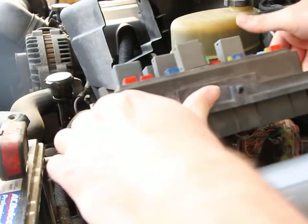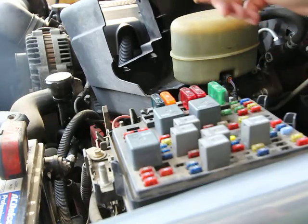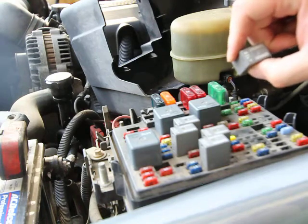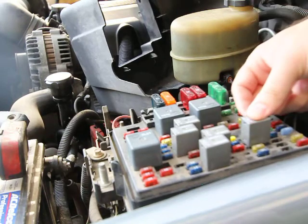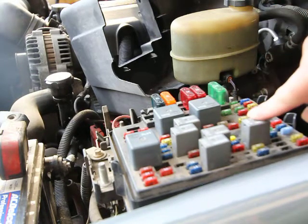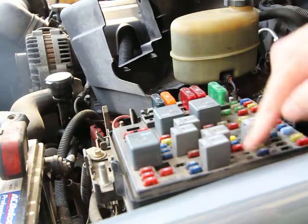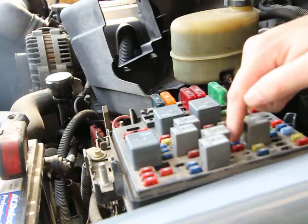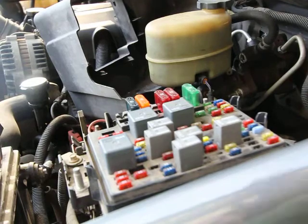When you come up to the top part, once you get your box reinstalled, you will have to come up to the top here — there are two fuses. Either you can use the 85-67 fuse, or there's a three-leg relay you can also use in there. Pop that into this location right here, which — it doesn't have a number location like the newer style trucks do. Anyway, top right of the box, or right side of the box, is the first relay spot. Then, directly over from that, you're going to have a relay spot that's not used, and then a 10-amp fuse most likely. The next one here is going to be an empty spot. So that fuse will be a 15-amp fuse — that is your fog light fuse.